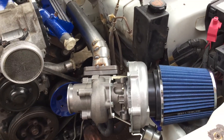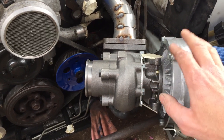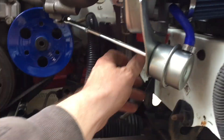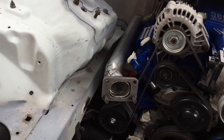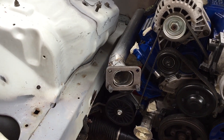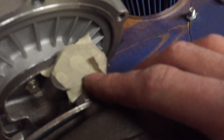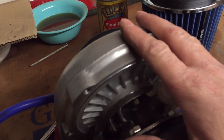This one I feel like it's pretty good with the clocking — all we have to do is just straighten that center one out a little bit, the housing is in a pretty good position. The other one I've got to really twist around — it's totally off, I think the whole oil feed is upside down. Got it to the spot where it's straight up now, tightening it back down and we're going to try to adjust the blower side.